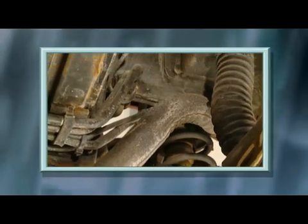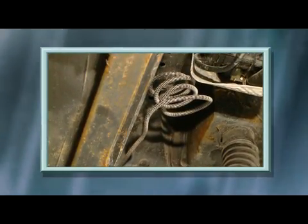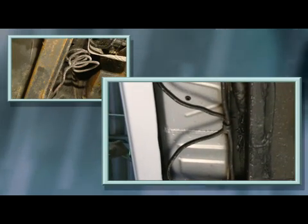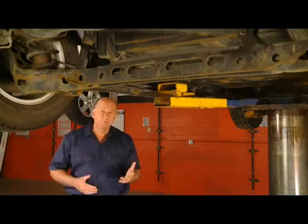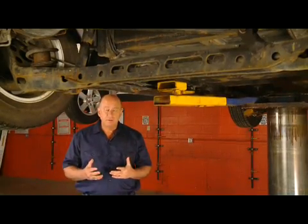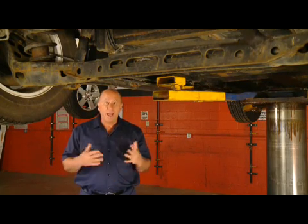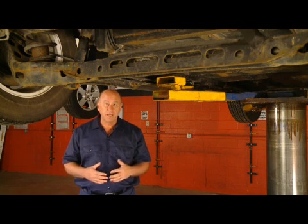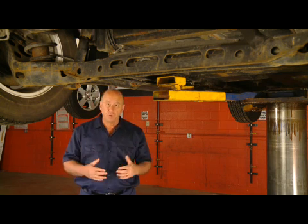In this case, the excess line was coiled and just suspended in a recess, and in the other, it was wound back and forth in a zigzag pattern. True, they didn't have to cut and subsequently reconnect the line, which would have taken time and money, but you also have all this extra just hanging here, where it can get snagged and kinked, and not to mention all of the extra brake fluid in there.